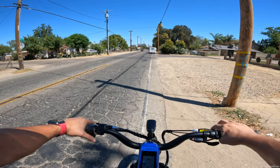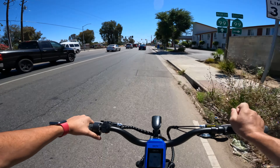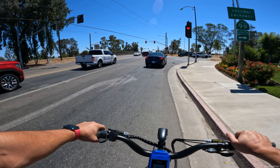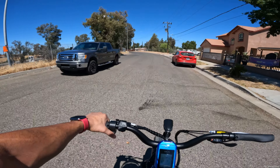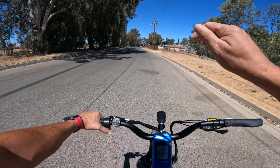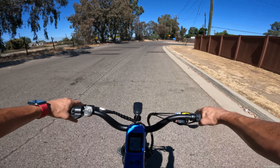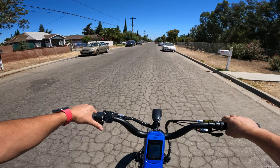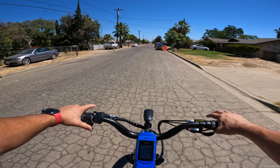Just a note — there's a very slight half-second delay when you hit the throttle before it starts moving. Also, when installing the front wheel, be careful. It's a quick release so I tightened it by hand and it wasn't tight enough. During my brake test it came loose and the wheel rubbed against the forks, messing up the sidewall. Make sure you really snug that down — double check when you install the front wheel.